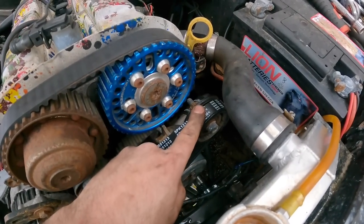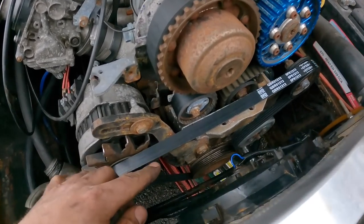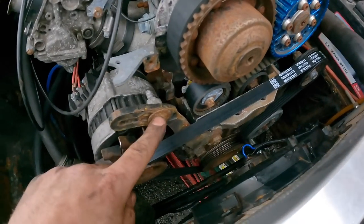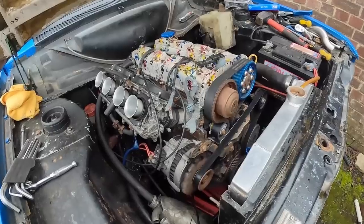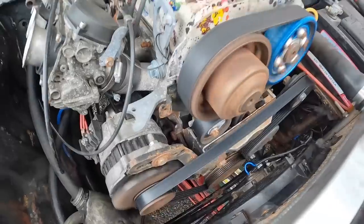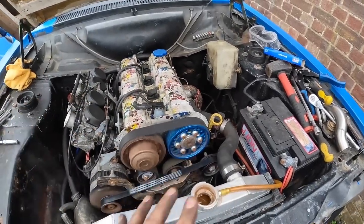With this setup you've got an idler pulley that adjusts the tension as well as the alternator bracket, so you can sort of manipulate whereabouts the belt is. I was trying to keep it away from this bracket because I assumed it was rubbing before. I've actually ground a bit of material away there to prevent it, but I need to drop that down slightly and tighten it up a bit more. So I'll rearrange it and then we'll go for another fire up. Well, that's a bit better — no more weird noises coming from the alternator. Hopefully that's not going to keep hitting that bracket. I might have to shave a little bit more off at some point, but I'm going to leave it running for a bit with the cap off, at least until the thermostat opens, just to get things circulating and make sure there are no leaks anywhere.